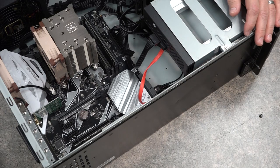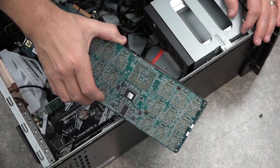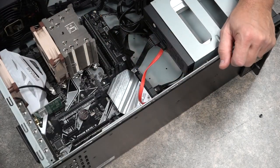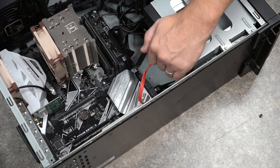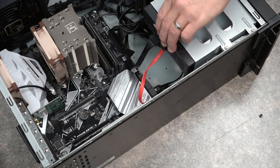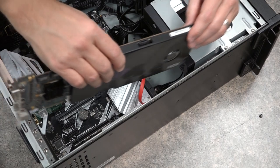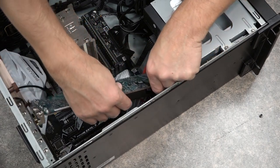I'm going to put it into this spot right here, and the first thing I need to do is take the little protective guard off. Another thing I'm going to do is loosen up this drive bay here a little bit, because this is actually a very big and wide PCI card and the space underneath here is kind of snug. Loosening this up just a little bit allows it to get in there a little easier, so it has a little room to flex.